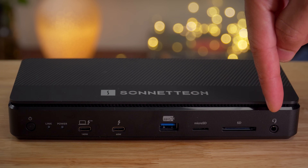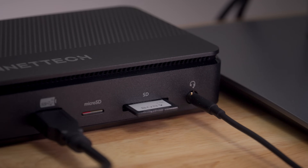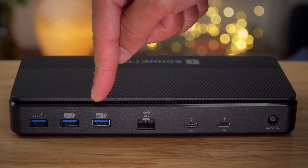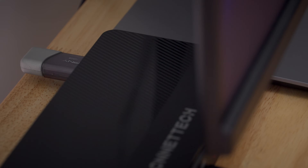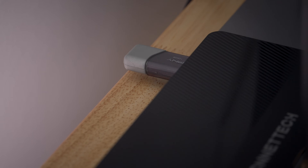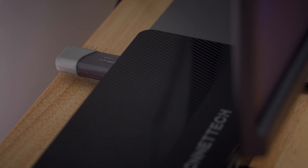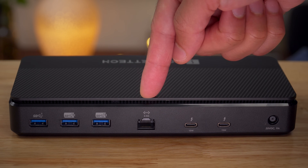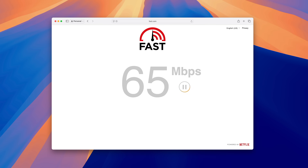The last bit of I/O on the front of the unit is a combo jack, which lets users connect headphones with a 3.5mm audio input or a headset with a built-in microphone. The rear of the unit features the two aforementioned USB-A ports with 10 gigabits per second and 7.5-watt power output, along with an additional USB-A port featuring USB 3.2 Gen 1 at 5 gigabits per second — more ideal for simple devices like mice, keyboards, and USB storage. Next to the USB-A ports is the 2.5 gigabit ethernet port, which is nice for high-speed internet connections that surpass regular gigabit ethernet. I currently subscribe to 2 gigabit internet service, and this allows me to take full advantage of that speed while connected to the Echo 13.